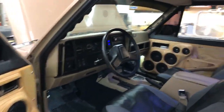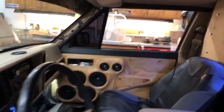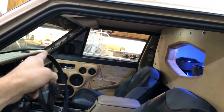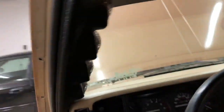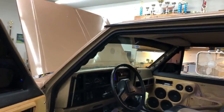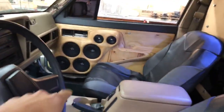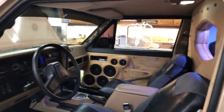There's the other door panel — I currently don't have the other pillar in because it's over at Gately Audio. We're replacing a couple tweeters because the silk domes don't seem to be happy taking SPL. If I seal up that side and meter like a bass boxing setup, you get over 160 decibels in that side of the car and I lost the bottom two tweeters to sound pressure. We may have to redo these pillars using a different brand of tweeter — probably a bullet style so they can take the pressure. I'll lose some of the Audio Dynamics clarity, but if we keep losing them we've learned a lesson.